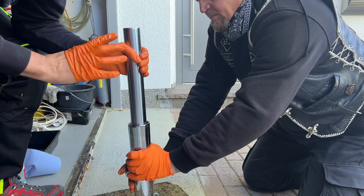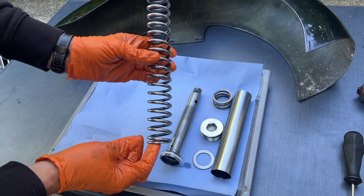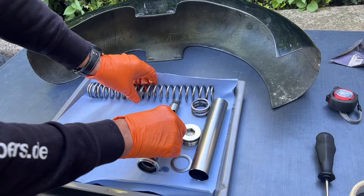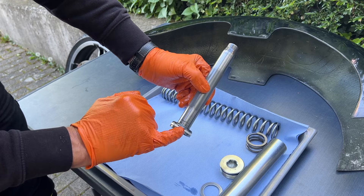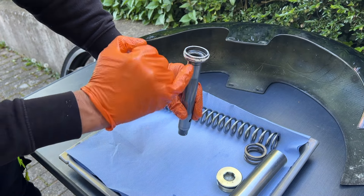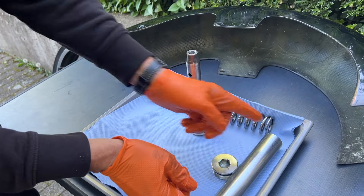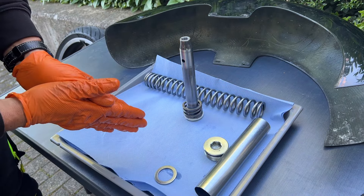The decision was to completely disassemble the fork. The first parts are disassembled — it's the correct Wilbers fork spring, laser-cut marked '516', correct for the bike. The damping tube looks fine. The seal looks fine with those grooves facing to the top of the tube. The washer was not missing, the top-out spring was correct, and the correct stock preload bushings. Still no clue what went wrong.